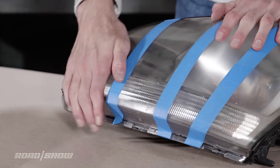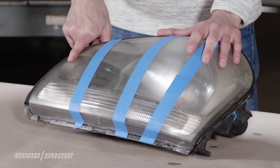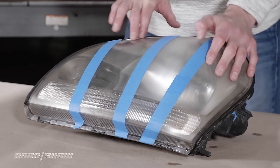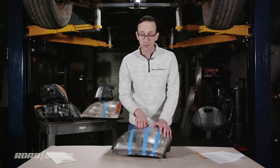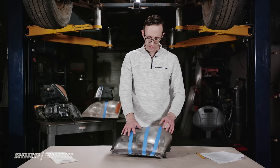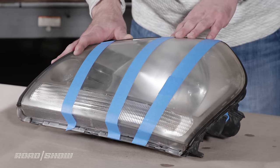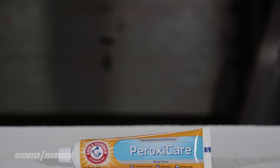This assembly has been washed and dried, and we can look at our results. The quadrant with just the spray lube is still pretty hazy — barely any different from the way it was originally. Next, the drill with the spinning polishing pad actually appears to have cut through a bit of the haziness — I'm a little surprised. I don't know how long it will stay like that once exposed to the elements and UV rays. And then there's the steel wool — it actually looks worse than the untouched section, with a lot of little scratches. My recommendation: don't take steel wool to your car's headlights.